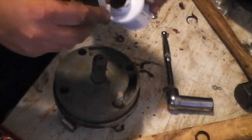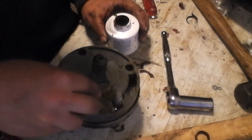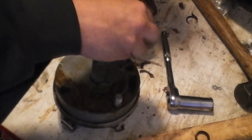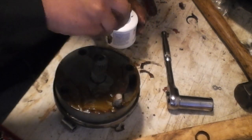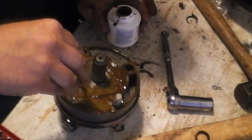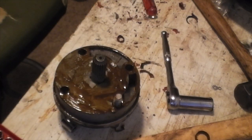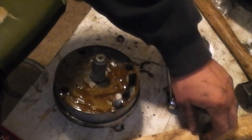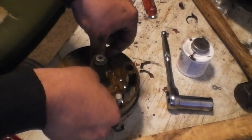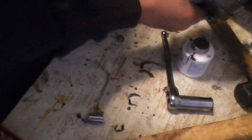Take your Make-A-Gasket and smear some on the mating surface. Don't forget the gasket that goes on the shaft — it comes with the new kit. Go ahead and slide it down to the bottom so it looks correct, then slide it back into the lower unit. Make sure you've got the holes lined up on there, and we'll put some gasket sealant on there too.